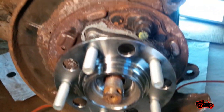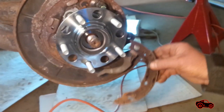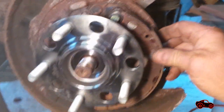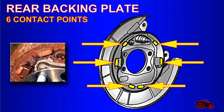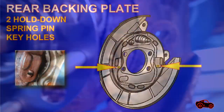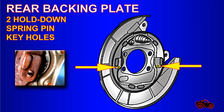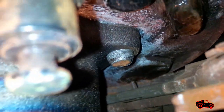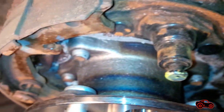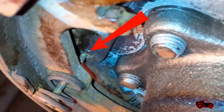When the parts were brushed, they were gathered together for reassembly. First, the parking brake cable was hooked up with the brake lever, and the brake shoe position was checked. A coat of brake lubricant was applied on the backing plate contact points. Before installing the hold-down spring pins, we took the time to locate and examine the keyholes. To lock a spring pin in place, it must be depressed in the keyhole, then rotated 90 degrees and released. For the spring pins installation, the brake shoes were spaced out in the upper section, allowing us to see the keyholes and ease the installation of the spring pins.